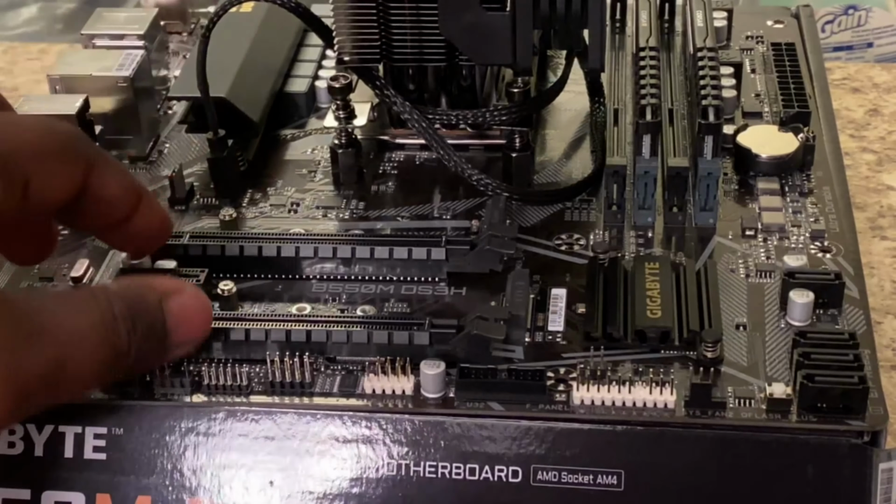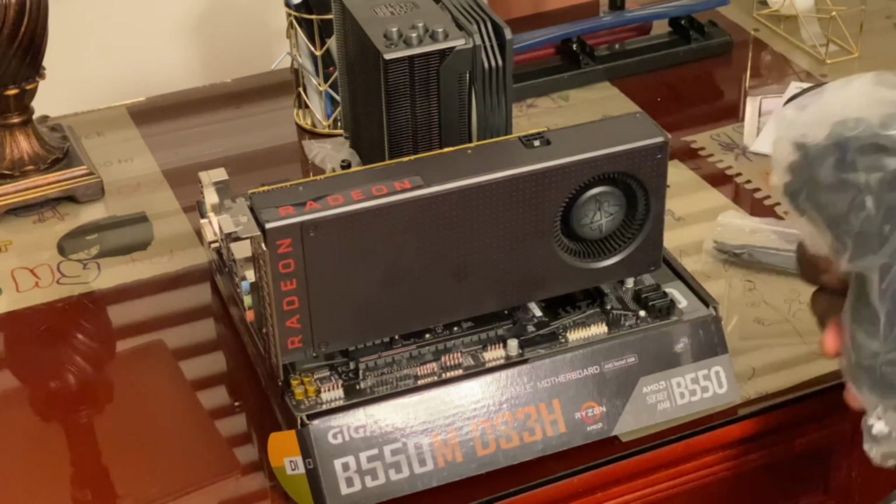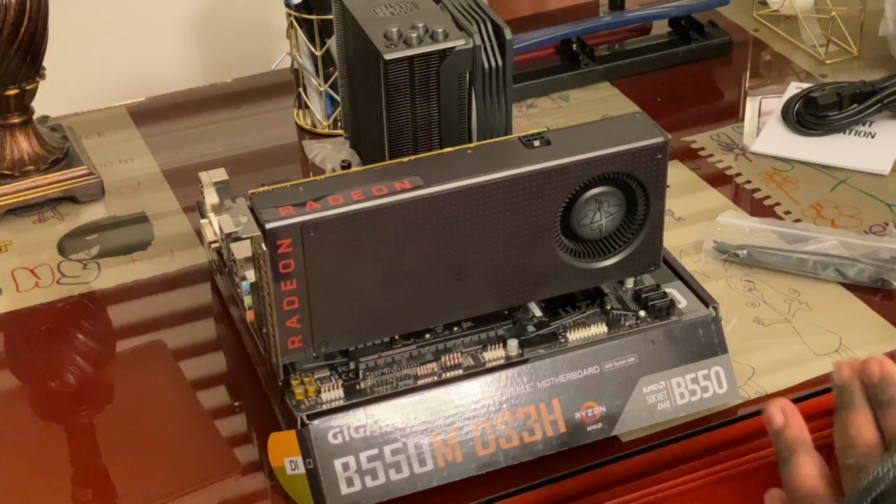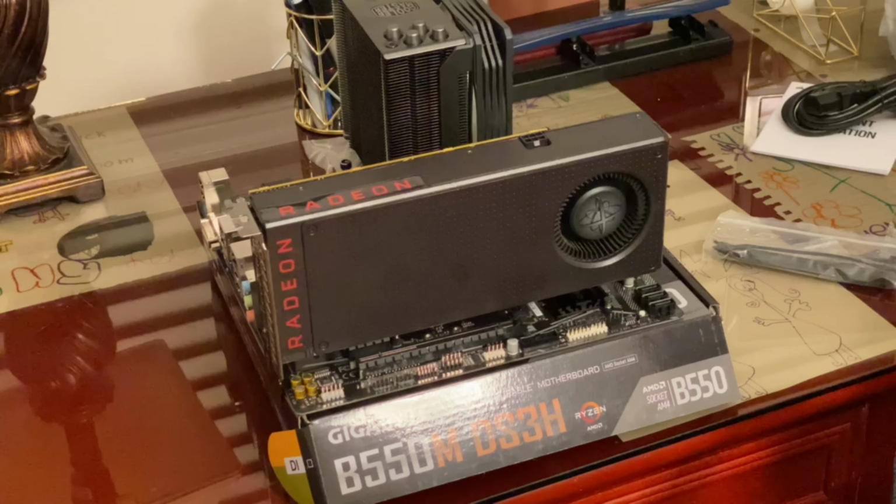power. So this power supply is semi-modular, and it's basically semi-modular because it gives you the two important cables that every PC pretty much needs, and that is your 24 pin and your CPU pin. And the others are optional. So your peripheral SATA cables or your PCIe, those are all optional and they come separated. So they're in this bag and you can plug them up if you need them. So this pretty much helps with cable management and not having a bunch of cables that you don't need.